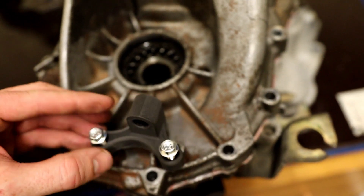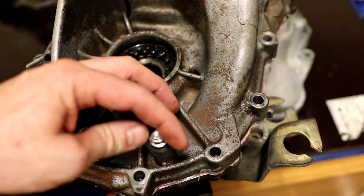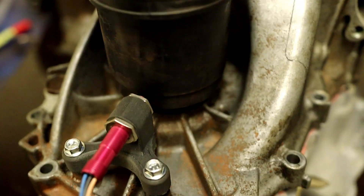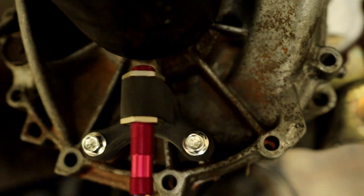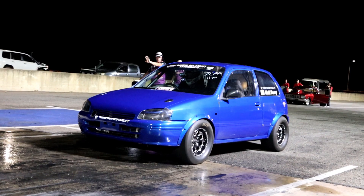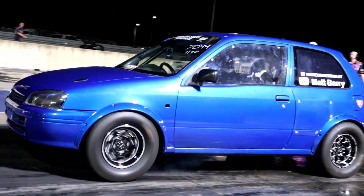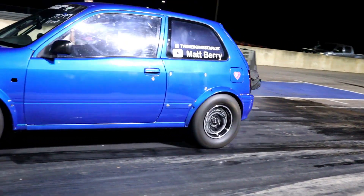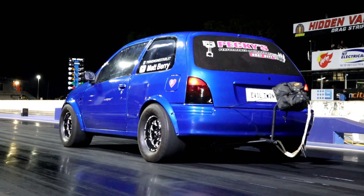One thing that's awesome as well about going this direction - having the engine speed sensors and also the wheel speed sensors being input into the ECU - it means that when we go drag racing or running the drag slicks, I have a nine-inch drag slick on the front, we can run the car down the track no worries. And then we could run the car on the circuit straight for the roll racing, which is pretty much just a basic road surface, and if we're getting any wheel spin it's going to compensate that. It also means that if I was ever to drive the car in the rain, we're picking up any wheel speed on the front, the engine ECU is going to pull the timing out faster than I can lift the throttle. So it's going to make it an all-round drivable car.